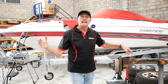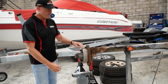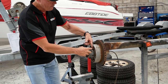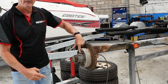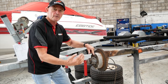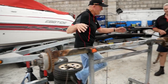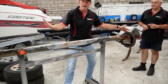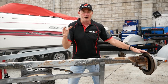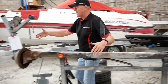This here is a disc brake axle. Measuring hub face on a disc brake — on the axle is where the stud comes out and where the base of the hub is, where the wheel bolts run to. On a disc brake it's this face here. Lots of people go and put the tape measure from the outer edge of the disc and run it all the way down, but what they're measuring is the disc, which has no real impact on where the wheels bolt on.